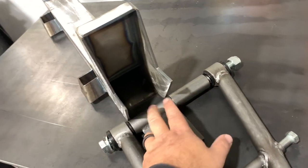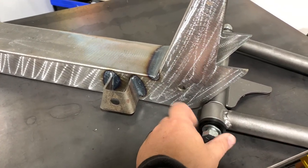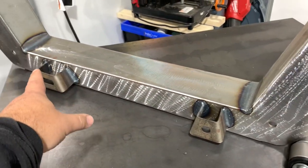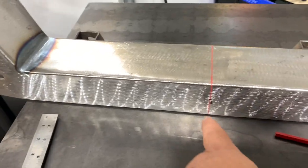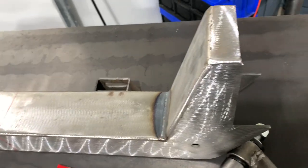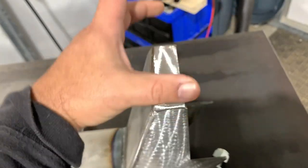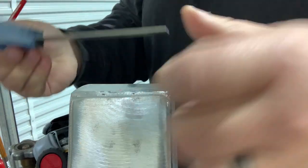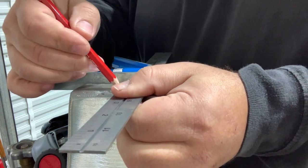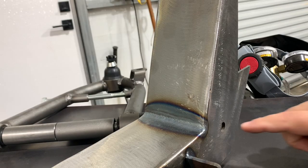They did however ship this backwards — this gusset goes on the back side of the cross member and this spacer gets welded in here. So I'm going to take this bolt out and flip these around. But before I do that, I'm going to take advantage of having these holes right here — they have to be enlarged to fit this bolt. I'm going to measure from one end of the hole to the other since they're nice and clean, find the center mark of my cross member, which is really an important part in getting it sitting properly in the frame. We're clearly marked here in the center on both the front and the top, measuring from the inside of each control arm bolt hole. I also need to find center on the side of the cross member because our spring hats — our top hats — get mounted onto the frame and they also need to be centered up in relation to the cross member itself.